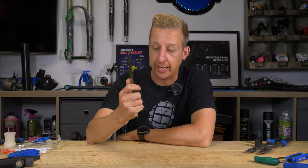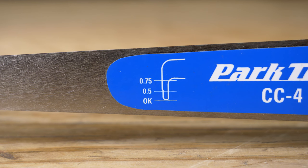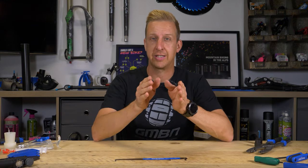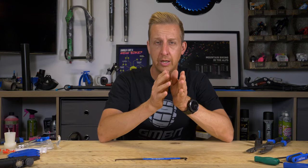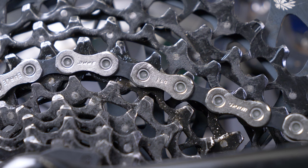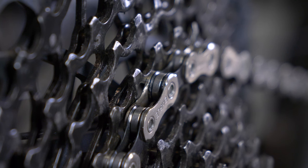A chain wear indicator tool. This is only good for one job on the bike, and that is saving your cash by seeing if your chain is worn out. Why exactly do you need to do this? Surely you just run your chain until it's worn out and replace it, right? Not really — as your chain wears, there's a phenomenon known as chain stretch. That's not the metal plates of the chain physically stretching. What happens is the pitch of the chain — the distance between the pins — gets very slightly longer as the components like the rollers wear out on the inside. When everything shifts microscopically along the line, maybe half a millimeter, those rollers no longer sit in the right place on your chain ring and rear sprockets, and they're going to get worn out much faster. By replacing the chain before it's fully worn out, you'll keep going on that same cassette and chain ring far longer. Otherwise you'll be having to replace all three components every time.